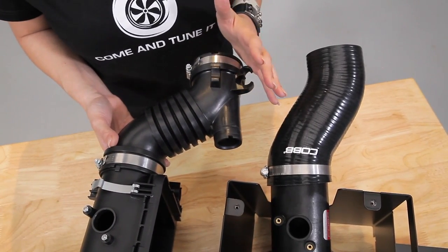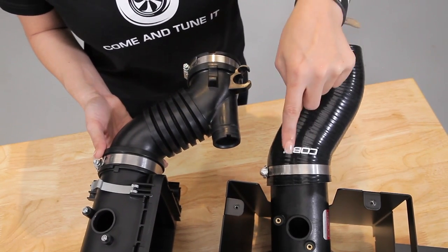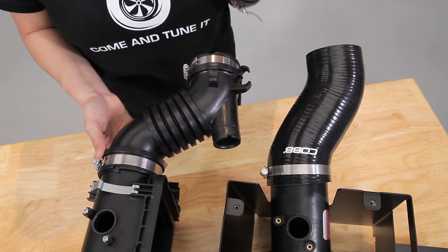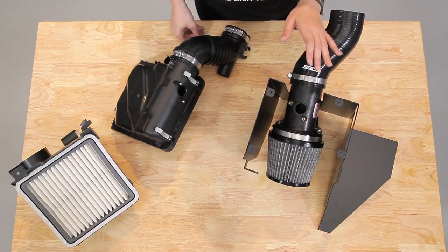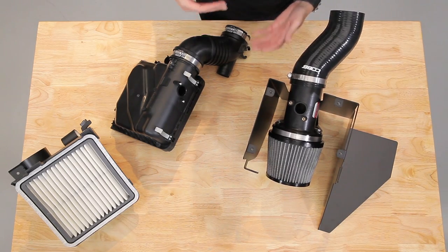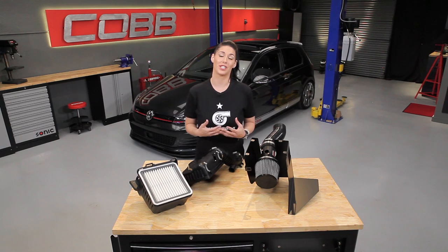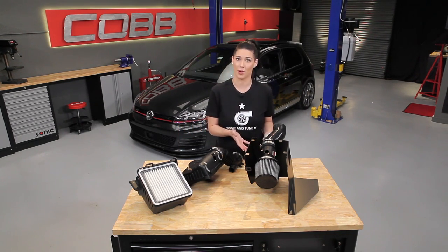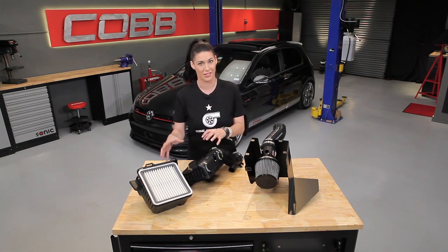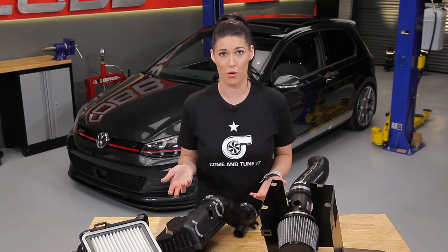Next is the diameter and shape of the tubing. The stock and Cobb tubes are similar in diameter, but the shape is very different. The stock tubing has a sharp bend and has this accordion section right here that makes airflow more turbulent. Cobb's bend, however, is shallower and smoother, making the flow of air more stable. On many aftermarket intakes the diameter may be larger. Any of these differences will have a big effect on the sensor's accuracy. Your ECU is calibrated to expect a certain amount of airflow based on the data provided by the MAF sensor. If the airflow changes — either by more or less volume or stability — the data will read differently. If your tune was designed for the way your stock intake flows air and you've just installed an upgraded intake which flows air differently, your engine's going to run poorly because your ECU will make calculations based on the stock data. These variances can seem small on the surface, but even the slightest difference in parts versus what the calibration calls for can cause poor performance or could damage your engine.